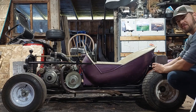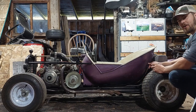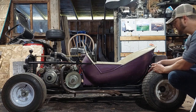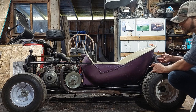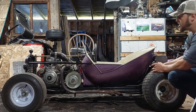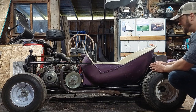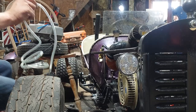that we have for this side. The old brake line just fits, but the ends on it are not changeable, and it's kind of on a weird angle where it comes into the rear caliper. So I bought a new brake line. It's a little bit longer. We can run it up the frame so it will flex with the swing arm, and it has changeable ends on it, so we can really get the best banjo fitting for where we're going to mount it.